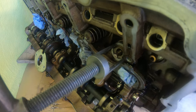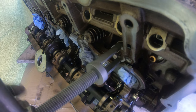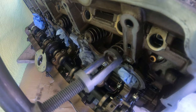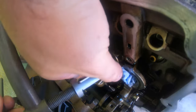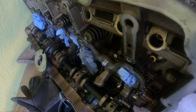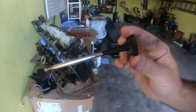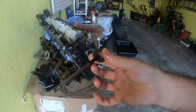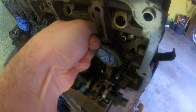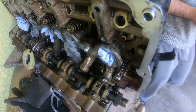These are going to be very hard to put back in, I bet. I'm just going to put these down and loosen this up. The spring and the hat come out, and then we can push the valve out. Now we want to pull the valve stem seal out — I have a specific set of pliers for this, especially to put them back on.